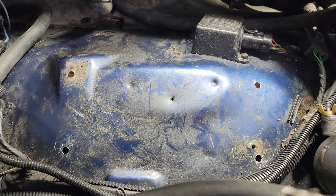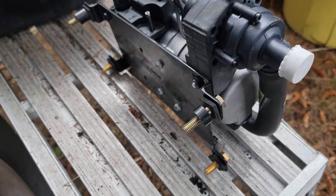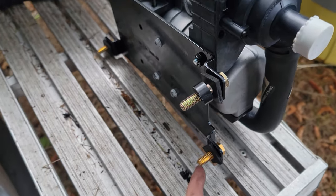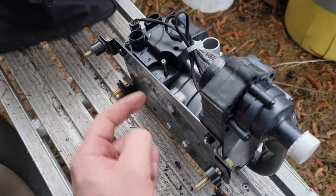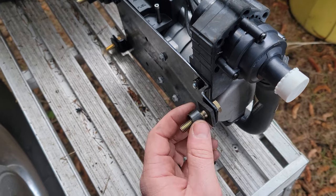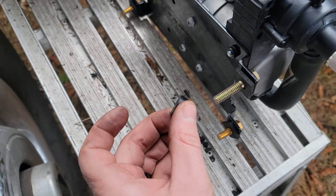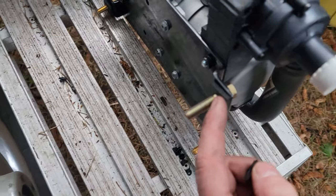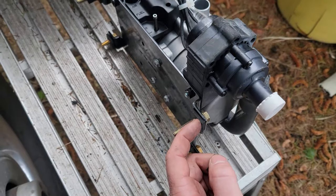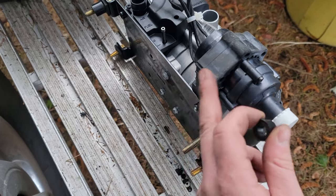Before I mount it, I've drilled four holes in the inner fender. On the Webasto I've got two one-inch bolts and two one-and-a-half-inch bolts. I made my own spacers out of plastic and cut a little angle on them because the inner fender has an angle, then cut some rubber pieces to use as rubber isolators on each bolt just to reduce vibrations on the unit.